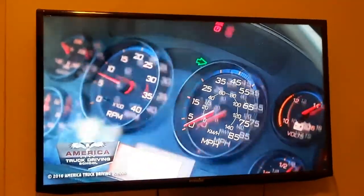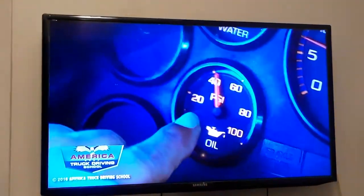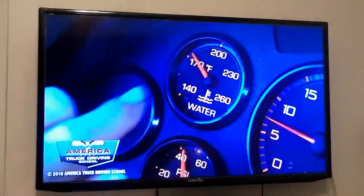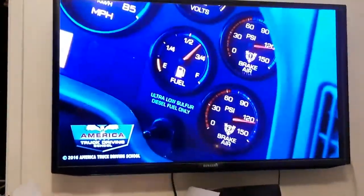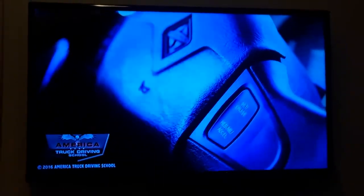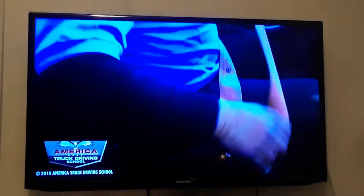Light indicators: the left and right turn signals, four-way flashers, and high beam — all indicators must work. The oil gauge must be working and between 40 and 60 PSI or normal operating range. Temperature gauge must be working between 180 and 190 degrees or normal operating range. Volt meter must work and be between 12 to 14 volts. The air gauges must work; the needles should move up and down when in use. Heater and defroster: both must work. Horns: both the air and electric horns must work. Emergency equipment: check for spare electrical fuses, three reflective red triangles, and a fully charged and rated fire extinguisher. Safety belt: securely mounted, adjusts and latches properly, not ripped or frayed.